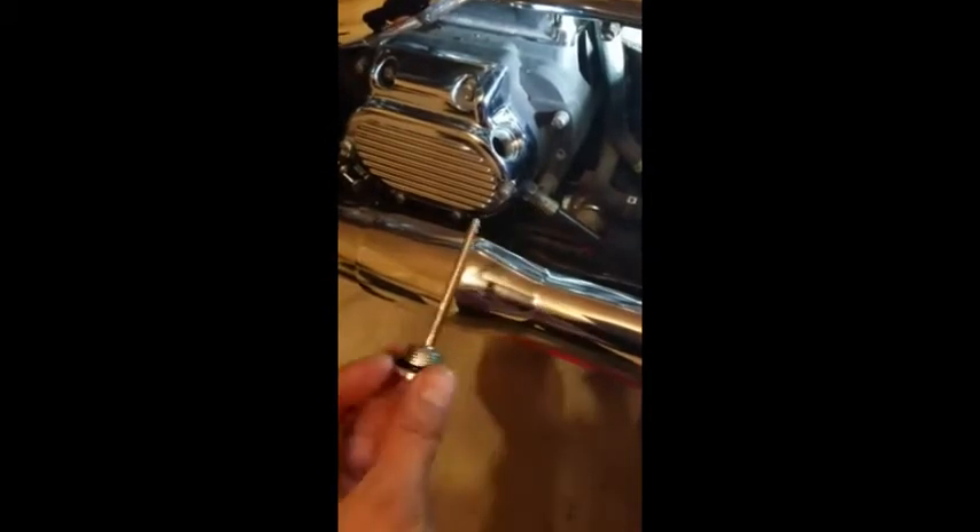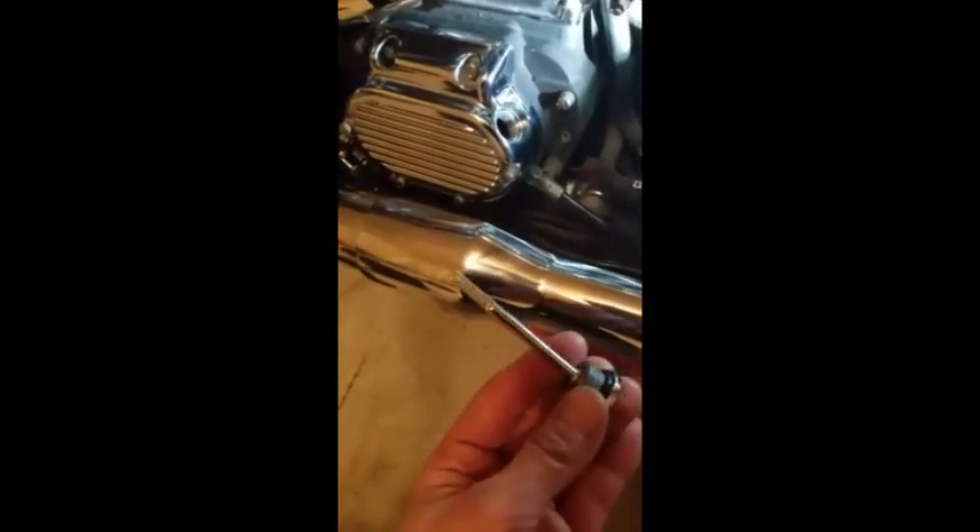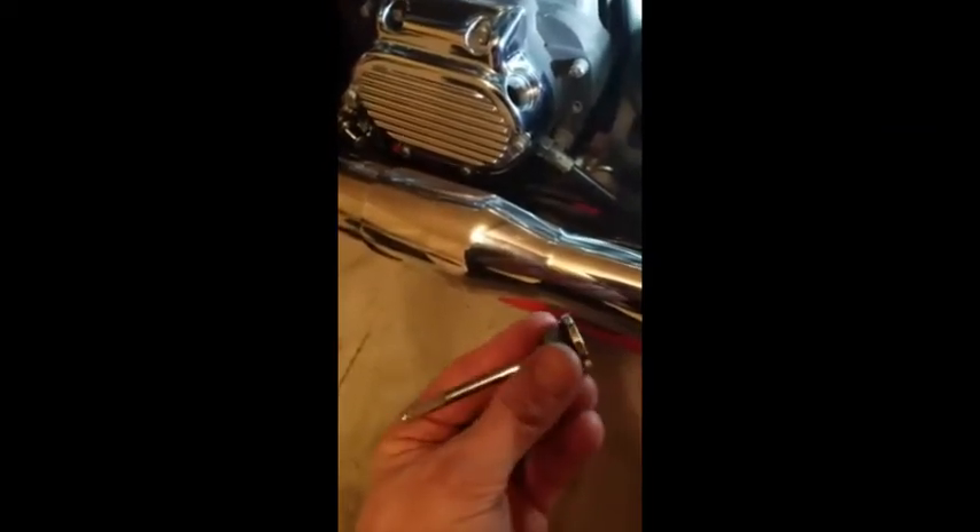I went through and cleaned up the dipstick for the transmission fluid. You can see there's an F and an A for full or add. There's also a rubber seal around the dipstick that I took off, cleaned up, and wiped down. Now we just want to reinsert that into the transmission casing and get it seated. Then go back to the 3/8 inch Allen wrench, screw it down, and tighten it up. The clutch cable in there tends to fight with how it gets inserted, so make sure after you have it all in there that you just hand-tighten the Allen wrench down so that seal can seal up the top of the casing.